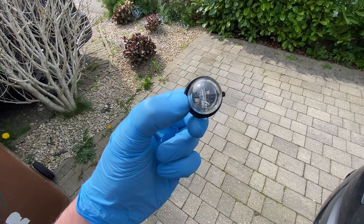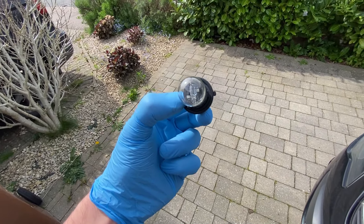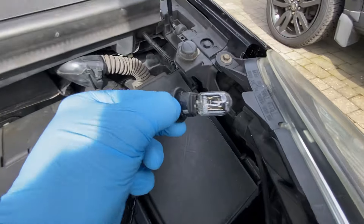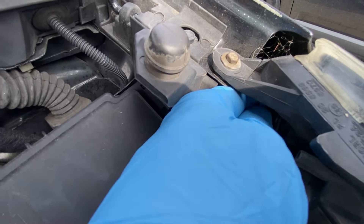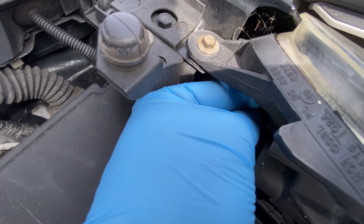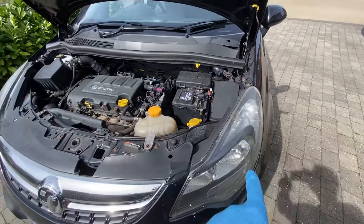With this one you've got a little lug on the right-hand side and that goes to the right of the car. So make sure that we've got that on the outside, then we can go back into the fitting, poke the bulb in, push it in, give it a little twist and it just locks into place. Then we turn the ignition on and we'll just check out these lights.